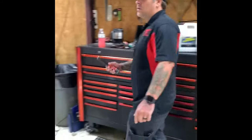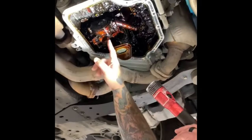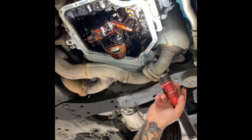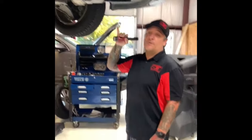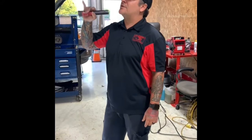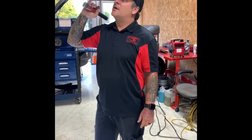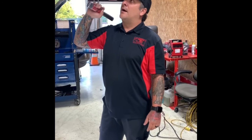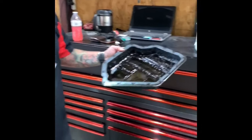Hopefully we can open the oil pan back up and we'll see a night and day difference. I'll show you what the oil looks like inside the engine — this is after we've taken the oil pan off. You can see it's pretty crusty and really gooped up. We've got a check engine light on this car, and it's due to the engine needing this oil to do the timing — how it advances and retards the timing — that's how you get better fuel economy. When it's not allowed to do that, the check engine light comes on.